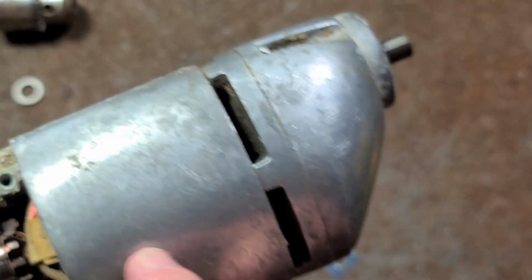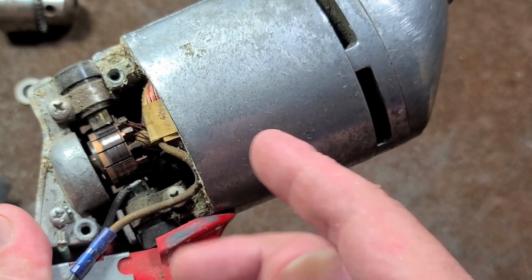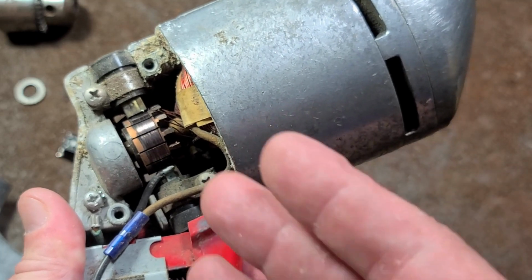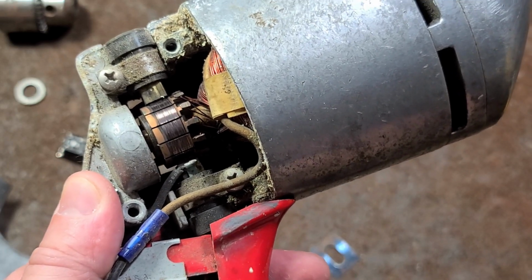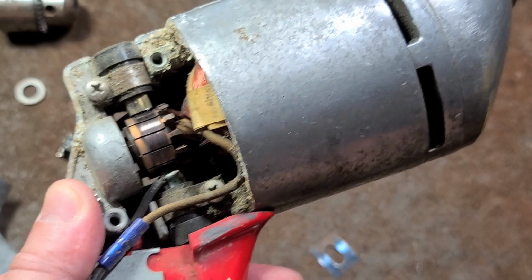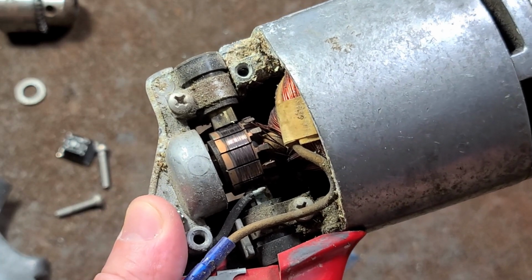A slower motor means that you don't have as much of a gear reduction, so that even though it has a similar amount of watts, it would have essentially less horsepower because it's spinning slower. Even though it's pulling 350 watts or whatever continuous peak, since it's so much less RPM, it delivers less power because it doesn't get to have as much of a reduction ratio.